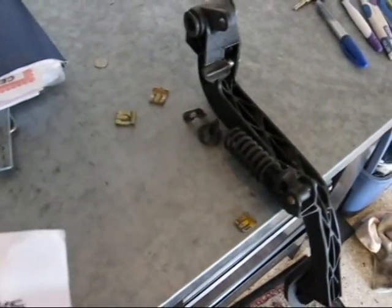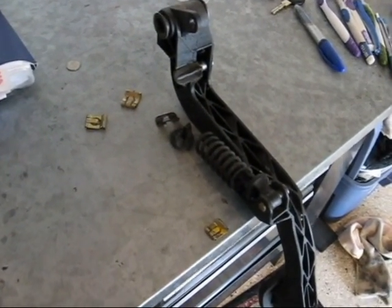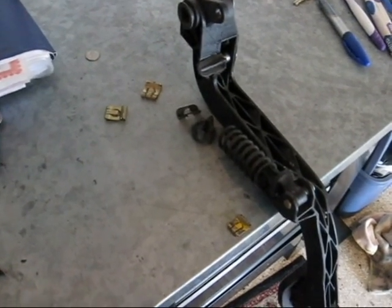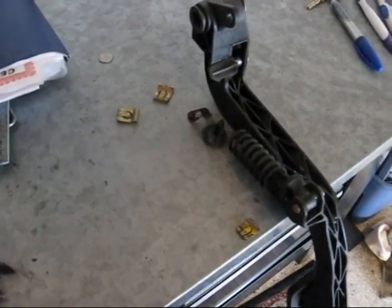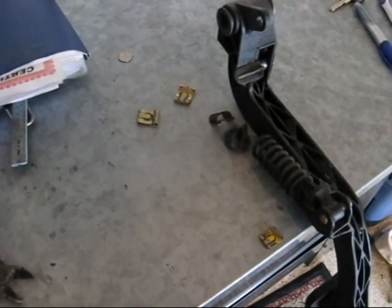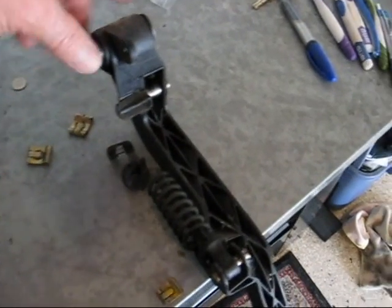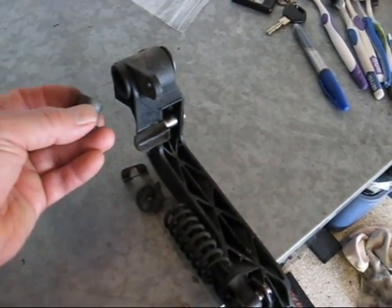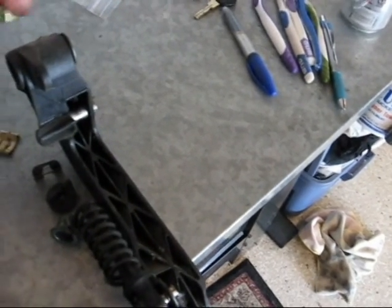Here's the pedal out on my bench. The UUC instructions said to remove the clutch sensor switch either by removing the bracket or removing the switch — I didn't have to do either one. What I did: I took the electrical connections off the brake switch and the clutch switch just to give myself a little room. Then I took the pin and kind of wiggled the clutch on the top. The top bushings are the plastic bushings that are too loose, and they're going to be replaced by the white bushings from UUC. But once you get this piece off, there's a lot of play here.